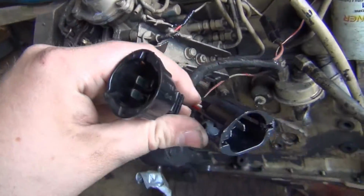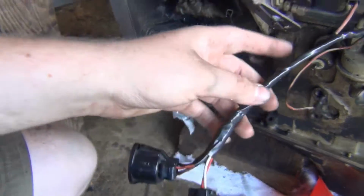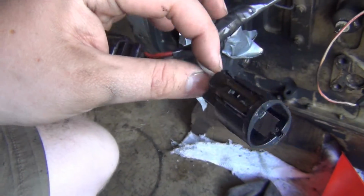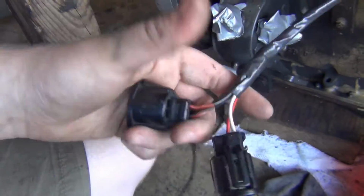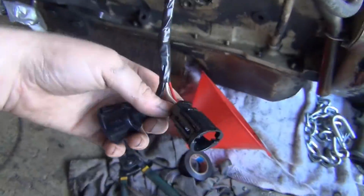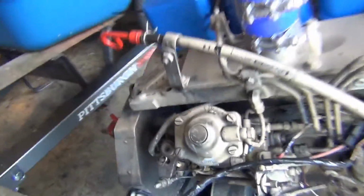And then, as I said, I got my two plugs. This one here for the power, I took off the brain box, which is just over there in that box, and just took the red wire. It's going to go to here. I believe this white wire is a ground. I'm not entirely sure, but I remember when I tested for power on the red one here, I just had the ground on my voltmeter attached to body ground, and then just touched the red wire, and it got 12 volts. So this will have body grounds and alternator and battery grounds on it, so this will be able to all work. And then this one here is just for the two sensors, oil pressure and water, sorry. So this is ready to plug and play.